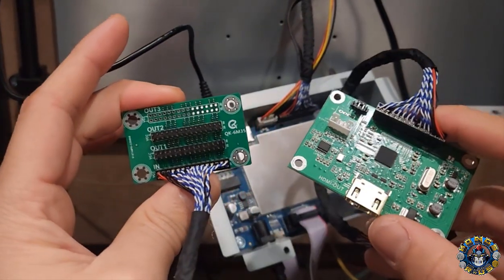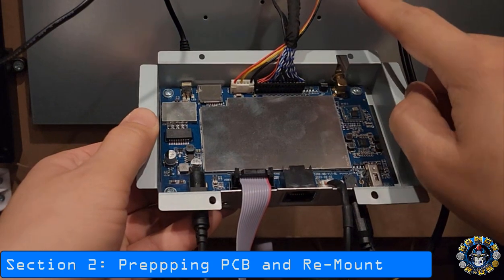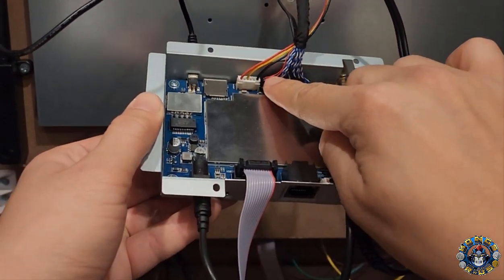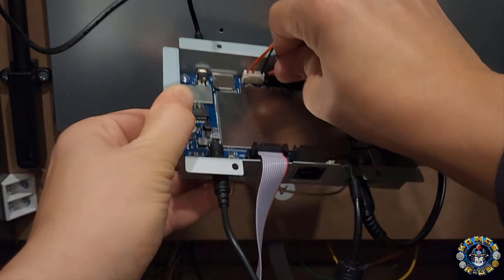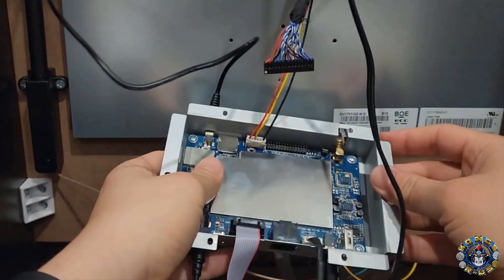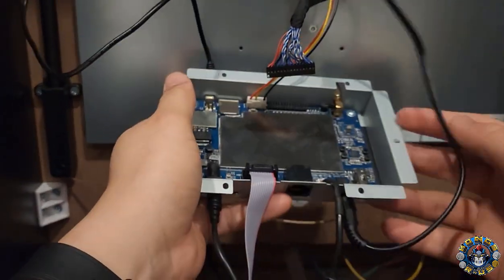Let's start with the PCB and make sure you remember what's connected to your monitor. This is the power cable as well as the LVDS strip with the red wire facing this way. Once you disconnect this wire from the PCB itself, the only thing holding this piece up is the power cable, so you want to make sure you find another way to secure it and not have it hanging. The extra wires are going to make it hard to mount.